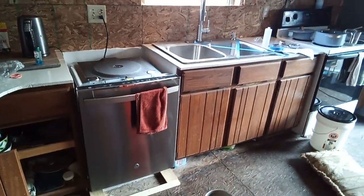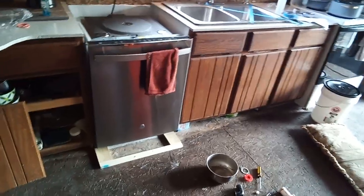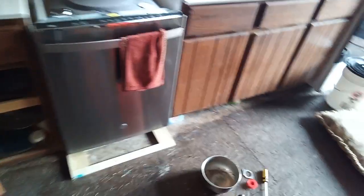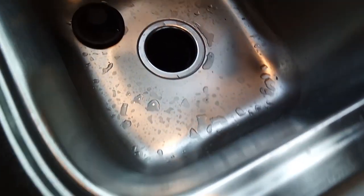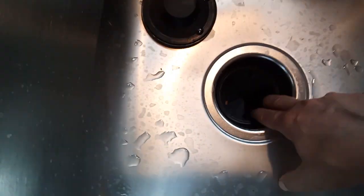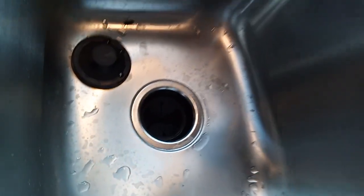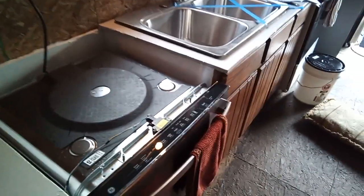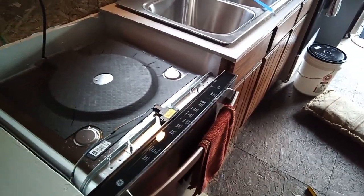But I've been caught up with this, and I was getting an FTD code, which is failure to drain, and then I realized that I had been a mental deficient, and there was a plug where the dishwasher drains into the garbage disposal up above here. And I saw it and I was like, yeah, I got to take that plug out. And usually when things like that happen, I just do it right away. And for some reason I didn't. And then later on, I thought I had already taken the plug out and I hadn't. And so it wasn't draining. But it is draining now.